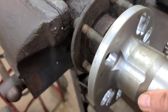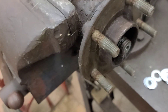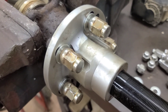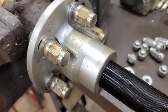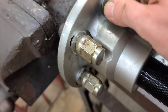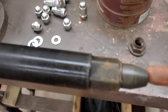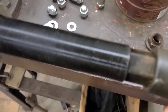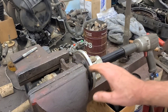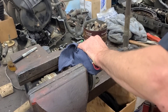Basically we need to bolt this on — you can see it's got all five bolts. Now you need to use flat washers to support it. Normally I'd put the nut back on flush, partly because you don't want to damage the end of the threads. I put some synthetic gear oil on the threads, and use washers underneath these nuts so you don't spread these slots — some of them won't spread but these ones will. This is a 30-millimeter hex, so we're going to tighten this up with the impact and then wail on it with a hammer to see if the shock and pressure will remove this axle shaft. I've got the bearing assembly clamped in the vise with significant pressure on it now.